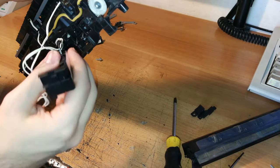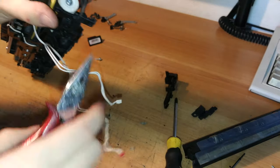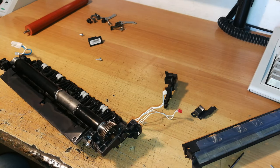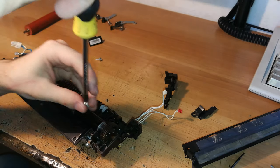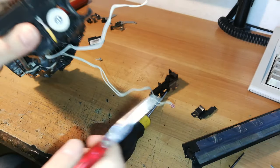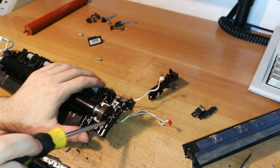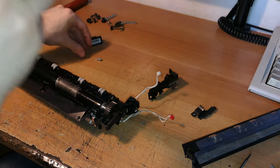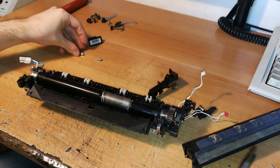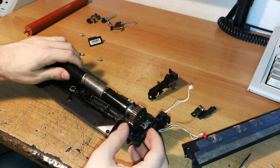You can actually leave this cover on, but we'll remove it anyway. Now I can disconnect this cable here. But before disconnecting it, I want to put this screw back in place just to avoid flexing the heating elements in any way. At this point we can proceed with this screw and the other one we removed, and then we can lift the entire heating element and roller.